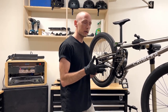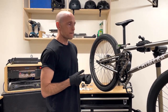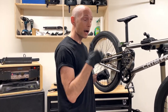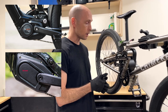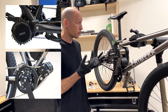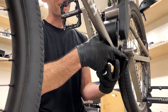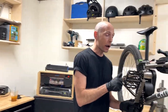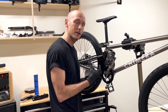Is that something common among e-bikes, or is that special to this? It's not common to mid-drive motorized e-bikes. Some of the higher-end mountain bikes use mid-drive systems — the Bosch, the Brose — and a lot of customized bikes use mid-drive systems like the BBSHD or the CYC X1. They're really cool motors, but they sit lower on the bike and sort of commandeer the whole bottom bracket area, and because of that they require you to use mid-drive-specific cranks and mid-drive-specific chain wheels — so proprietary parts.